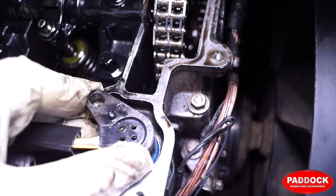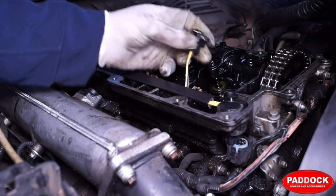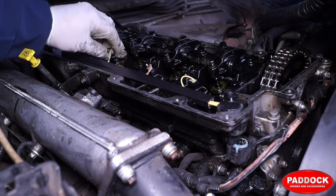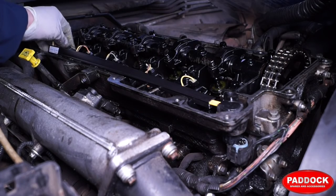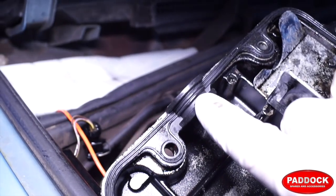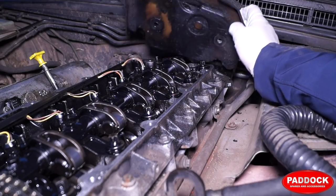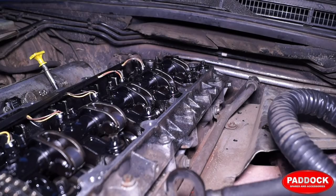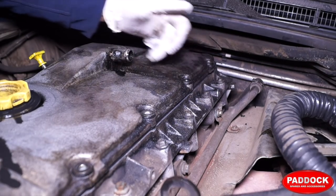Fitting the plug into place — there's no need for a sealant. A little bit of lubricant on the seal is good enough, then position it so it locks into place. Fitting the injector plugs is easy — just click them into place so they positively fit, and you can't get these wrong as they are in sequence from 1 to 5. The bar will sit down and it's held down by the rocker cover. The gasket is ERR7094G and it has an anomaly at the back of the engine which can be a real pig to fit.